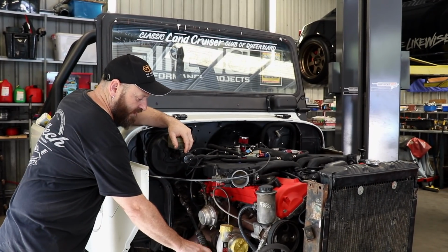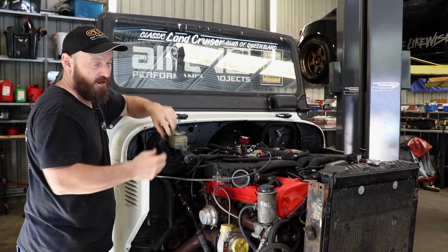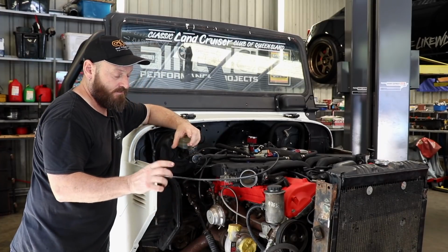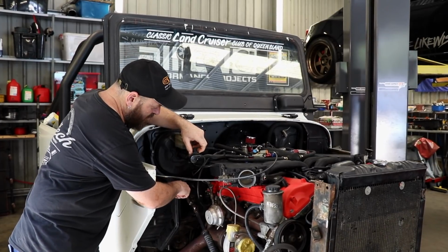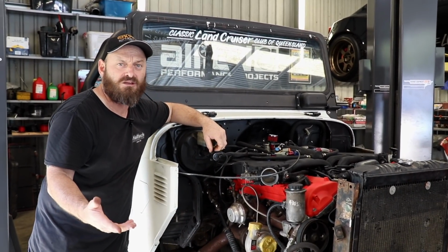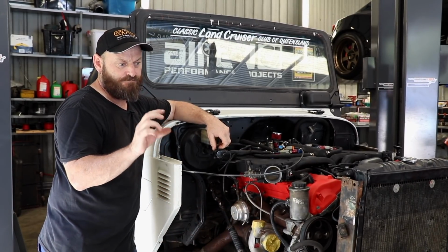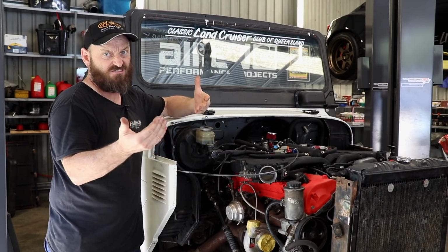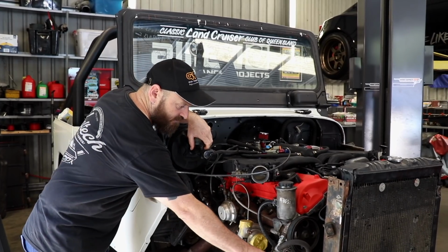So we're going to put a double cardan joint there, which is basically 2 unis built into one that allows you to go around a sharper corner. And all of it's going to be replaced with bolt together stuff. This is 11/16 36 spline on the output there, and also on the steering box. For some reason I can buy them, I think because hot rod guys use Toyota steering boxes, so they actually make that spline on one end uni with a double D bar, which is your standard easy to work with way of doing steering. So we've got half and half there.